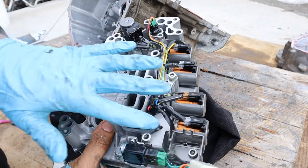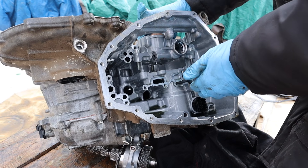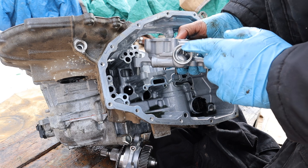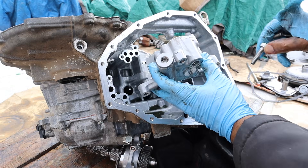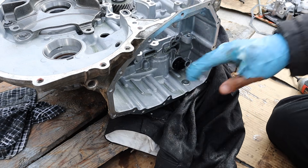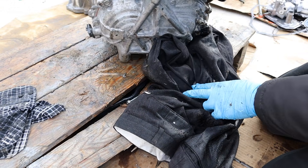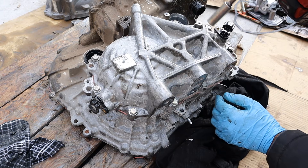Here's the valve body with all of its solenoids. Now I can access a bunch of hex bolts from the top which allows me to pop off this piece, the oil pump housing. You can see this is the oil pickup area that was fed from the valve body from the oil filter. This is the housing, and this is your oil pressure regulator. Now that we're done with underneath and the top, we're going to flip this over on the other side to access the half of the transmission that has the actual guts we're looking for — the CVT belt. The transmission has a rear cover; we remove all the 12mm bolts.